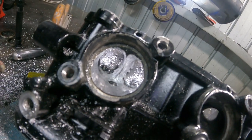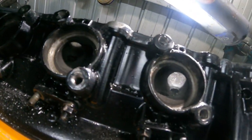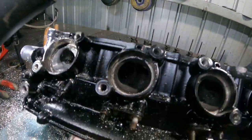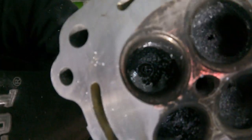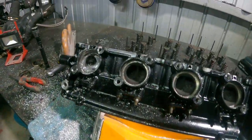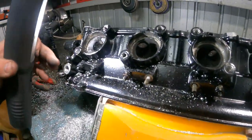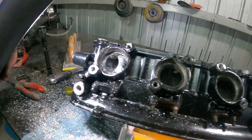You can just see how big the port is. It's all come up well. I've just done a little lick on the tops as well so far. Then we'll re-seat the valves, clean the valves up, re-seat them, and the port job will be done. We're going to clean everything up as well obviously. Let's continue.